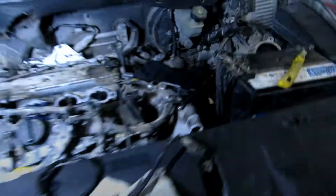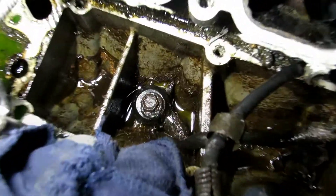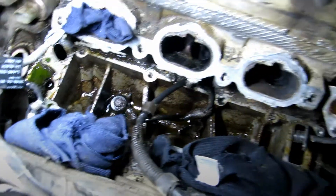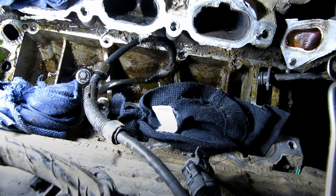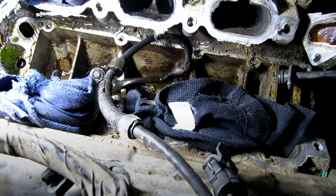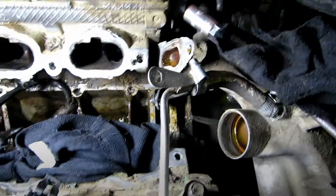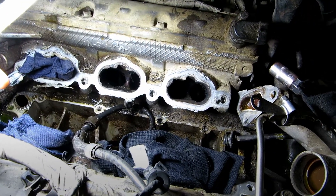Even before you remove the air cooler, you have to remove this thermostat housing too. Then you get down here and you get your knock sensor. The knock sensor is right here, under the engine oil cooler, where the oil filter is situated.